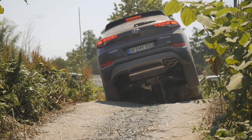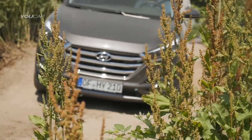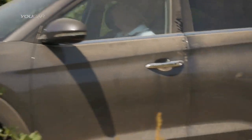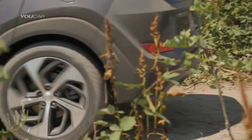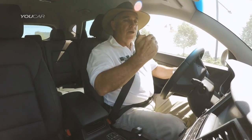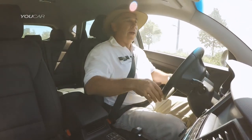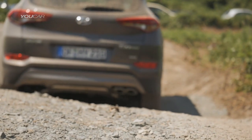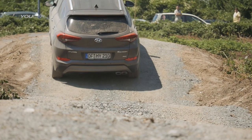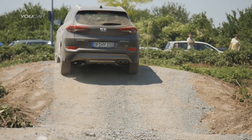As we come in here we can feel the car shifting on the road. What happens is we drop into a hole and it lifts the rear wheel by about a meter — that's called a cross axle event. Driving across here going through some elephant footprints, just gently letting the car roll through them, always remembering that what the front of the car goes through, the back of the car has to go through as well.